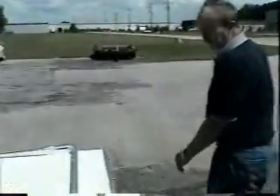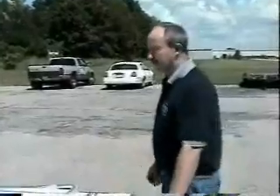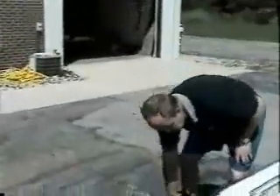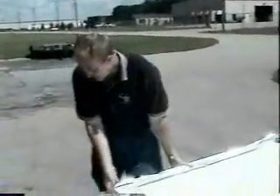The last thing I want to talk about — and this is critical — is how you store the trailer for the winter. If you don't have a place to store it out of the weather, we recommend storing the trailer on a good slope so you don't have water or snow sitting on the top of it, and let the tongue completely down. But the really important thing about storing it is that because the trailer is so watertight, if you leave it totally closed up for a long period of time, it will collect condensation inside. To compensate for that, get yourself a small block and put it between the lid and the side wall so everything inside can breathe. You can cover it with a tarp if you have to leave it stored outside. If you leave this trailer closed for a long period of time, it will collect enough condensation that you'll start to get mildew on the carpet and the screws will start to rust.